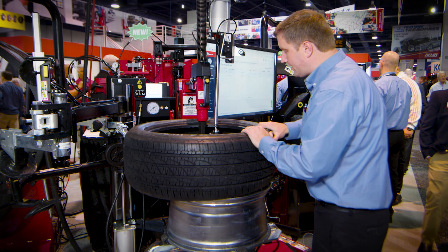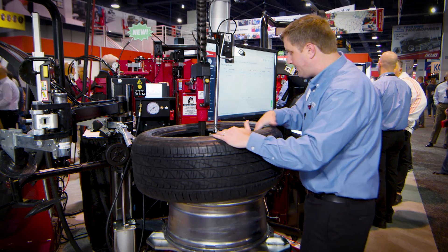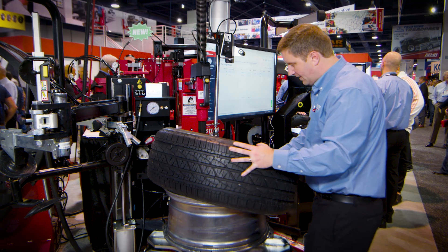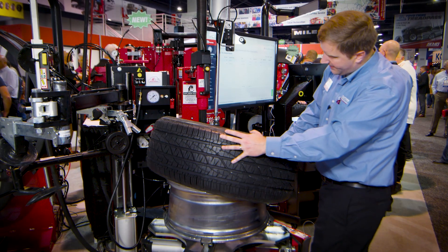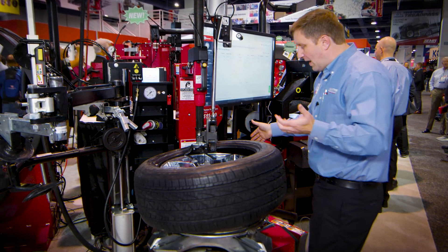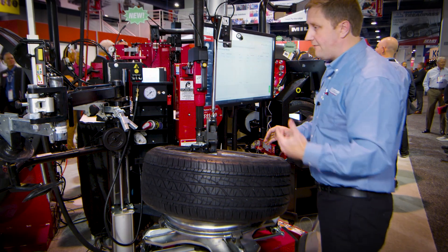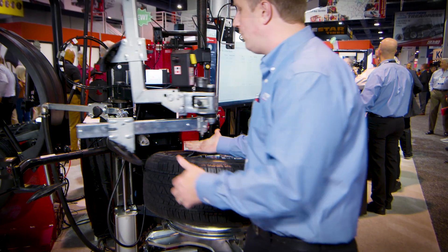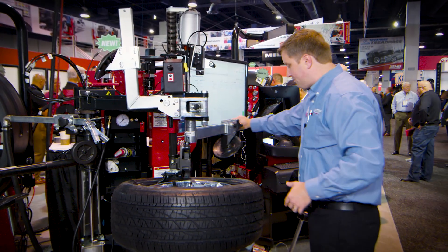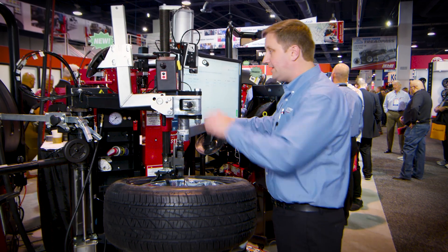I can of course use my lower locking disc to demount larger bottom beads, but this leverless mechanism really makes those bottom beads a lot easier. This head is a standard polymer levered head — it's actually the same exact head from our levered model. So that means no need for inserts; it's not a steel construction with inserts that could be missing or damaged and potentially damage a wheel.